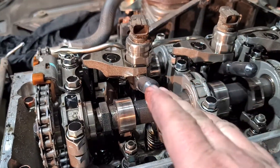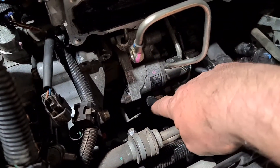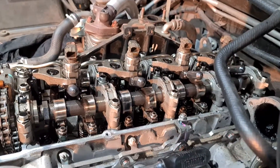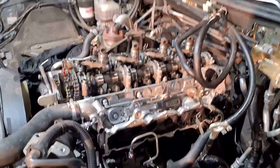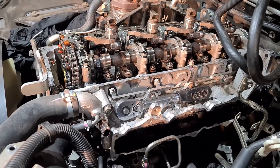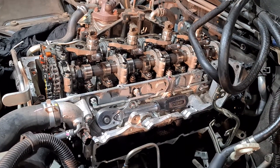I've capped all of the injector entry points as well as the high-pressure fuel pump. It's absolutely paramount that you keep everything clean — get rid of all the debris, dirt, sand, whatever is around the engine bay before you start working on these things. I see videos on Facebook and YouTube where people are just ripping this stuff apart and not even considering the contamination that's happening.